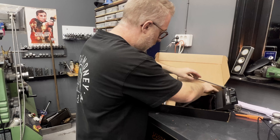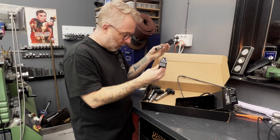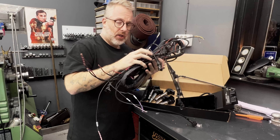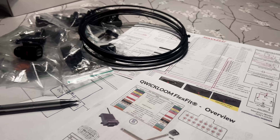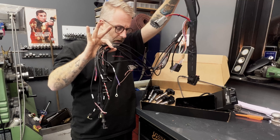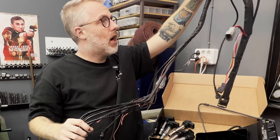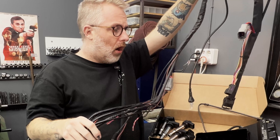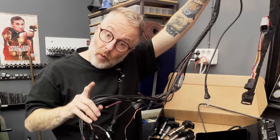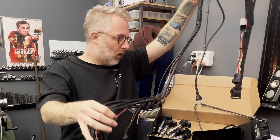Then there is a wideband lambda. Also five new coil-on plugs because the original Volvo ones aren't very reliable. This is the VAG Volkswagen thing that everybody uses — they are very reliable, apparently, which is nice. And then the last thing for this ECU setup, except for a ton of wiring diagrams and plugs, is this semi-ready-made wire loom. It's not completely ready-made because some wire ends don't have plugs on them. It's about half the price of a MaxECU one — same professional grade but not completely finished, so it suits a lot of cars. I just have to crimp on the correct plugs for my engine setup and probably shorten some wires. So that's a big thing.